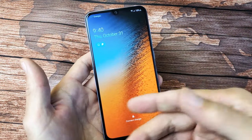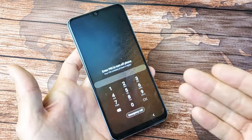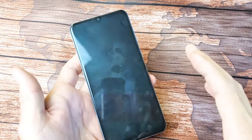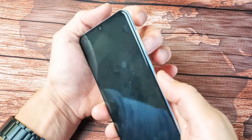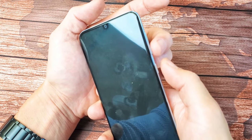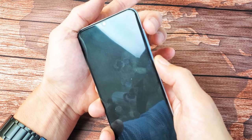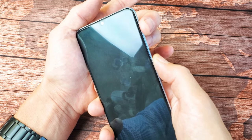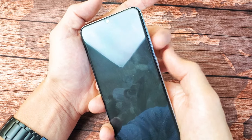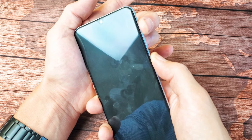However, my phone is on and let's pretend I forgot my password so I can't turn off my phone — it keeps asking me for a password. So how do we bypass this? What we need to do is force it to restart. Once it's about to restart, we need to switch keys. Press and hold the volume down and power button for about 10 seconds. After 10 seconds, only release the volume down button and press and hold the volume up button. Never take your finger off the power button — always hold the power button in.